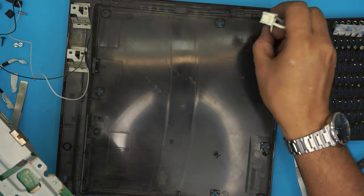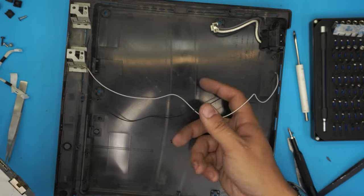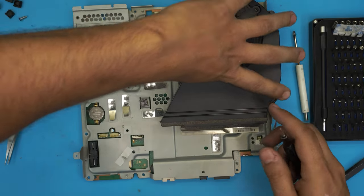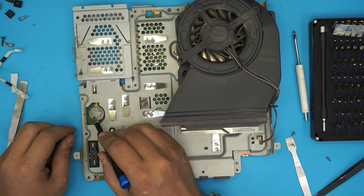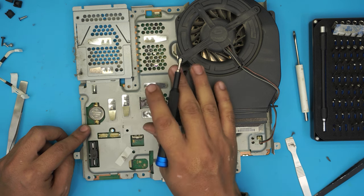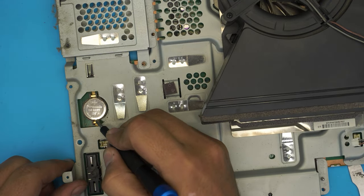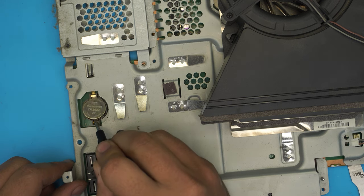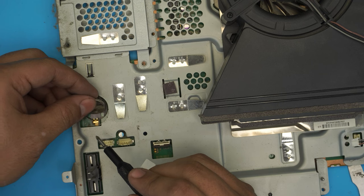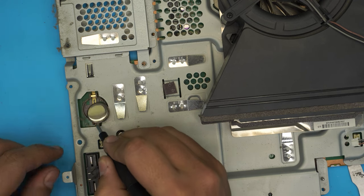This is the bottom cover — go ahead and clean it up. You can leave the Wi-Fi antennas or remove them with one screw each if you want to replace them. First, remove the BIOS battery — it's a CR2032; I'll leave a link in the description. If the console doesn't hold the date and time configuration, you may want to change this battery. To remove it, pull the trigger backward and the battery comes up easily. To reinstall, put the flat side down under the trigger and push it in; removal is from the trigger side.